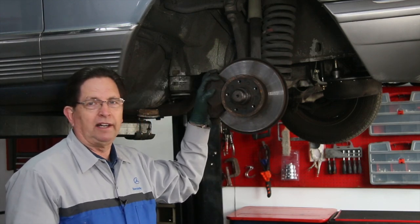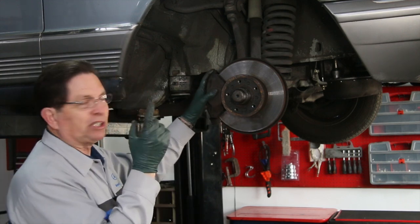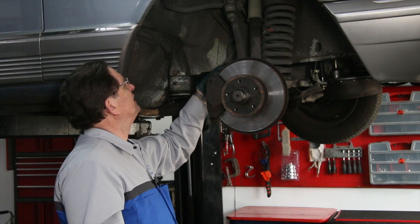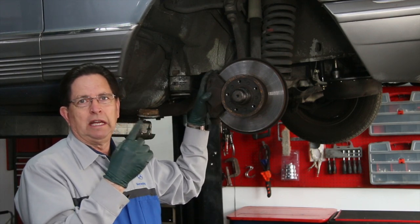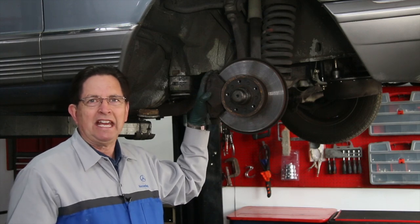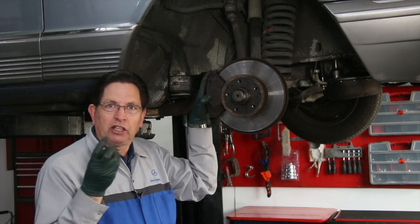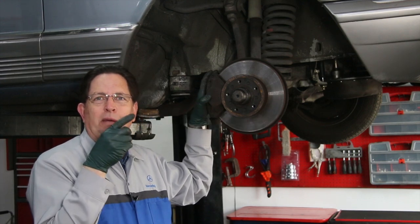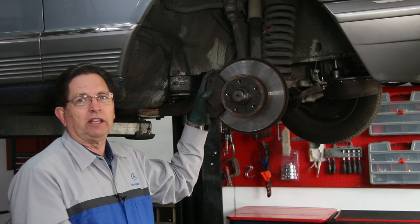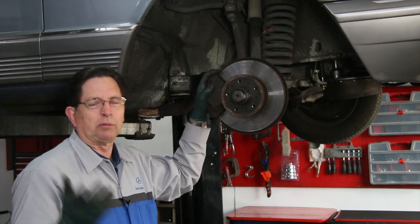As far as the other three wheels, I'm okay. I'm going to have to get a new rotor, a rebuilt caliper, and new pads, and install them on that rear hub. Then we're going to do a complete brake fluid flush. I'm going to inspect all these flexible hoses for any cracking — these look like they've been replaced. Unless you have records that those flexible brake hoses have been replaced, when you're doing the brake restoration on your old diesel, change those four hoses. They're not expensive, but they can actually rot internally and affect the braking pressure. Worse yet, they act like a check valve — they'll push fluid through but when the fluid tries to come back it won't let it, and the brake will drag. The pads will actually drag because the caliper is not totally releasing. On all these old cars, unless you know hoses have been changed in the last five to ten years, change those four rubber brake hoses when you do your brake restoration.